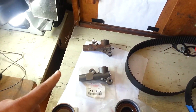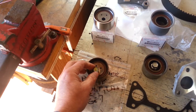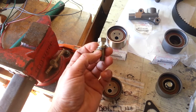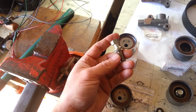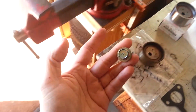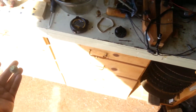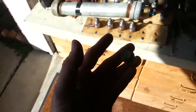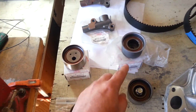We removed the tensioner by first removing the tensioner pulley bolt. You'll notice there is a flat washer and a lock washer that are captured, so there's no way to replace just the lock washer. I suggest replacing the entire bolt — make note of the grade, which I believe is a grade 7. Go ahead and replace the washer, lock nut, and bolt with new pieces.